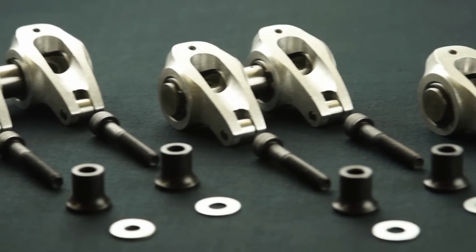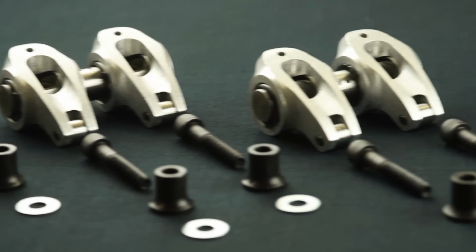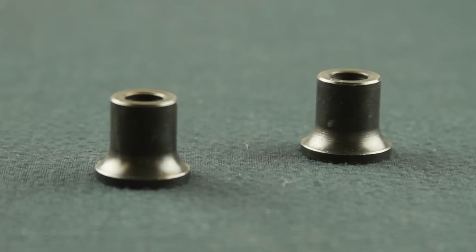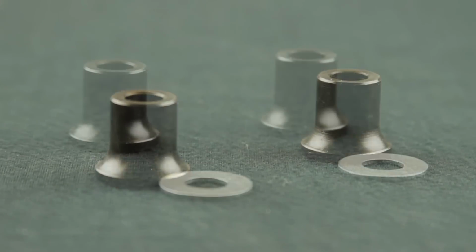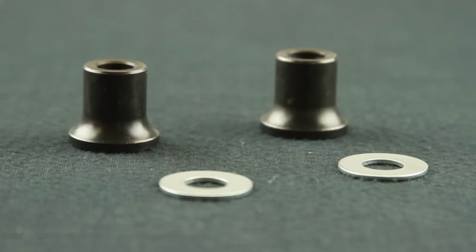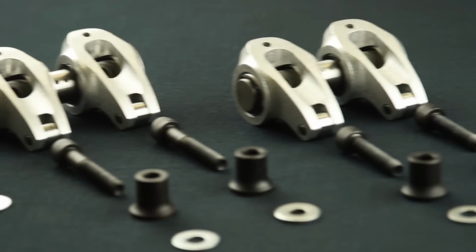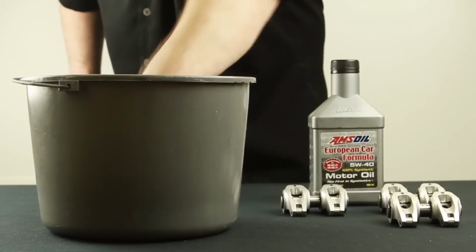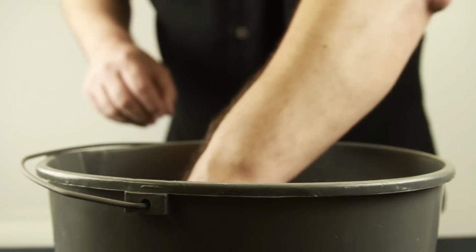Yella Terra shaft mount rockers utilize a common shaft supporting 2 rockers for each cylinder of the engine. Each rocker assembly is supported by a pair of inflexible supports called pedestals. The pedestals can be raised with the included shims for easy geometry adjustments. All hardware is included with the kits. Rocker arms should be soaked in engine oil prior to installation to ensure proper lubrication during warm-up.